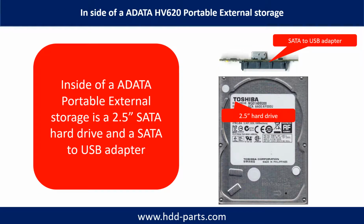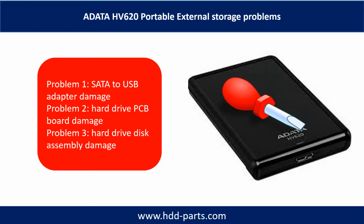Inside of an ADATA HV620 Portable External hard drive is a 2.5 inches SATA hard drive and a SATA to USB adapter. The ADATA HV620 Portable External hard drive problems can be categorized into three. Problem 1. SATA to USB adapter damage. Problem 2. Hard drive PCB board damage. Problem 3. Hard drive disk assembly damage.